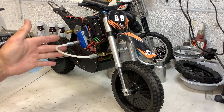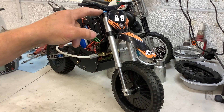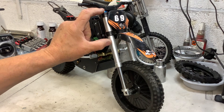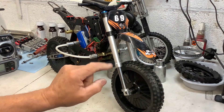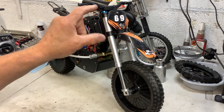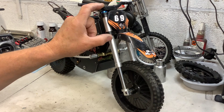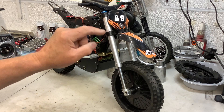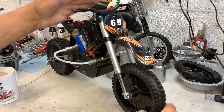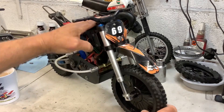It's got really good suspension on the back. On the front wasn't so good — it just had springs in there. But what I've managed to do is screw-cut a thread on the inside of these blue bits on the top, and I've got big buggy shocks in there — old dampers — and the rod comes down and bolts onto the top of these. I bought cheap buggy suspension with shock absorbers off eBay and found they fitted in there really nicely. Just put a thread in there, screwed them in. You can adjust them, change the oil thickness. The suspension is absolutely beautiful — no bouncing, nothing. Really lovely soft plush suspension.